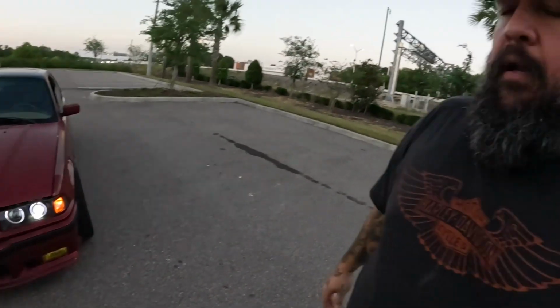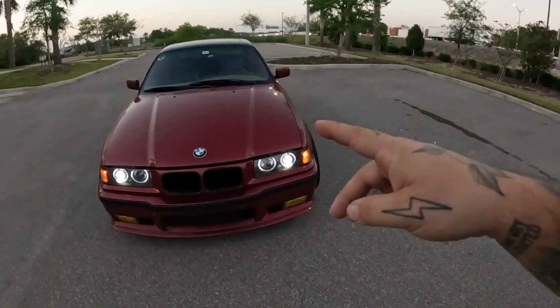Guys, so a longer term follow-up. Did I solve the idle problems for good? Yes, but there was a thing that I didn't record about this car that I need to show you guys right now. That was also one of the main issues. Step one, if you guys are having idle problems, check your vacuum. Check for all vacuum leaks, knock all that stuff out. There was a huge tear in one of the tubes coming off of the idle control valve. That tear, huge vacuum leak, obviously.